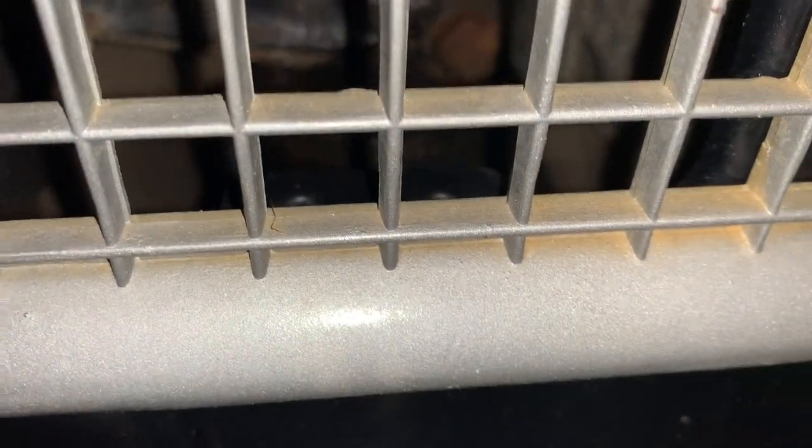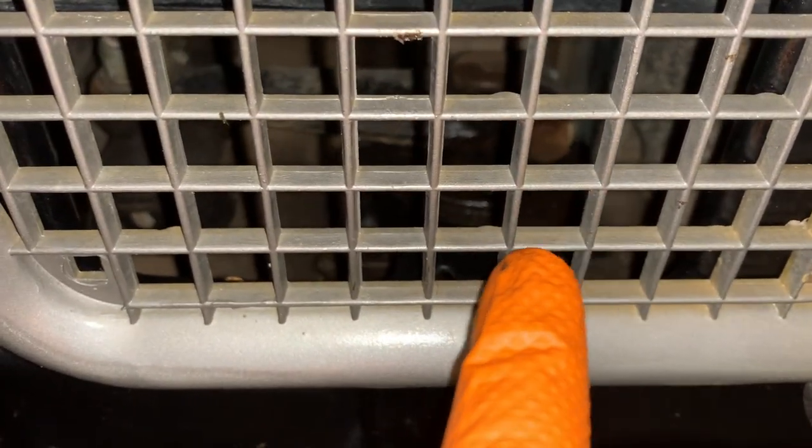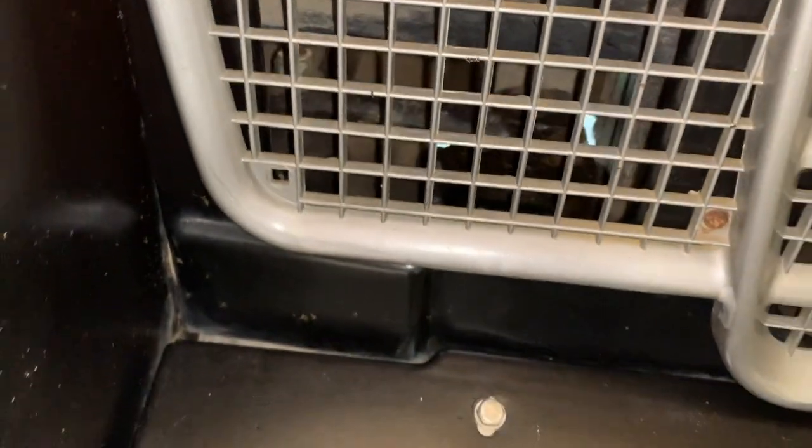Now, I hope you'll excuse the quality of my videoing here, but the steering relay is the dark black thing lurking in the depths in there. I need to loosen two nuts off the top casing, not more than two, otherwise the top case will fly off. One to let the air out, and one to let oil in. Absolute horrible job. There's another ball joint hiding in there, and there's another one way in the darkness in there. They're a nightmare to get to.